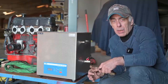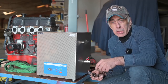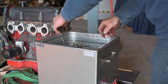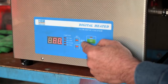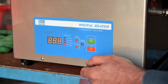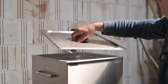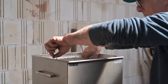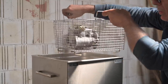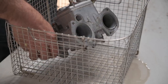So what I'm going to do now is submerge my carburettor fully into the ultrasonic cleaner. I'll set the temperature to 80 degrees centigrade, power to high, and frequency to high. Let's have a look at how the carburettor cleaned up after about 15 minutes. It looks pretty clean - not 100 percent, but clean enough to start working with it. The first cleaning worked pretty well.